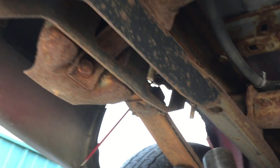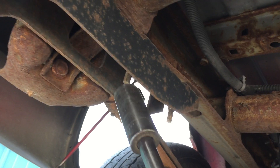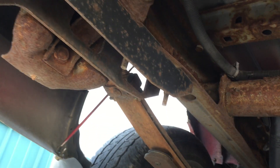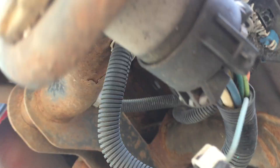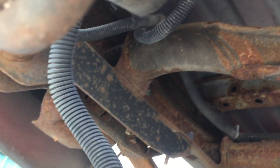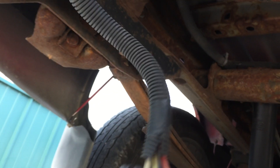You might have a bad day if you drop it on yourself — this thing is kind of heavy. So go ahead and do the same thing there: top wrench on those two, buzz that one out. Before you take the last one out, one word of caution: unplug your trailer hitch light pack. You don't want to stress that because sometimes these things are brittle and they will break.